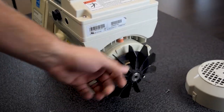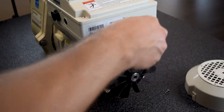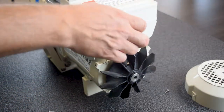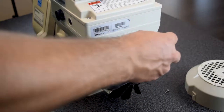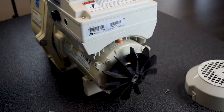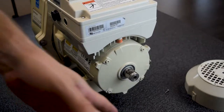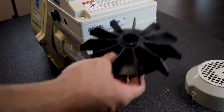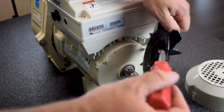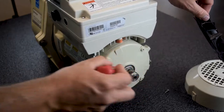So this is kind of a weird one. What you're going to want to do is take a flathead screwdriver, pin it in there, and your first instinct is to go away from it like this — don't do that. You want to grab the inside of the metal and then kind of pull away, and the fan will literally just come right off. So now my fan's off. Fan blades get broken; people sometimes accidentally hit them with a screwdriver in the back. So it's really that easy. Pretty much what it was: I stick my screwdriver through this hole right here and it grabs the inside right here, and that way it kind of wedges that plastic off.